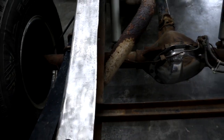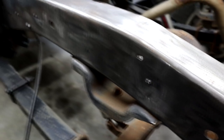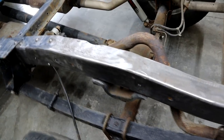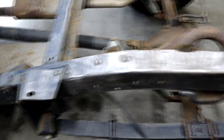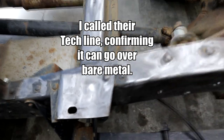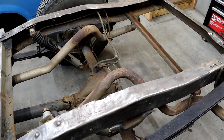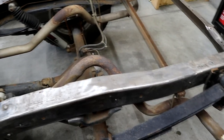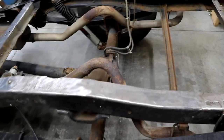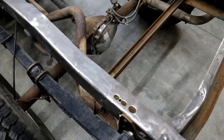I don't even know in the first place if I should have brought this down to full metal, or if I could have just painted right over it. I looked it up and Eastwood Platinum Encapsulator is supposed to be able to go over bare metal, so that's probably it for today. I'll flip the truck around, drop the rear end, and have more room to take care of underneath the frame and the insides.